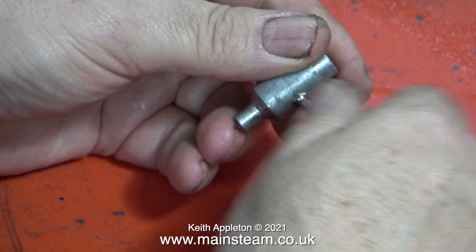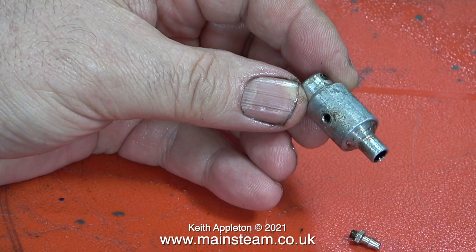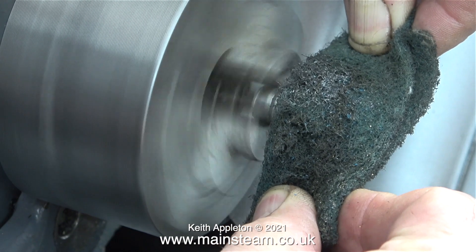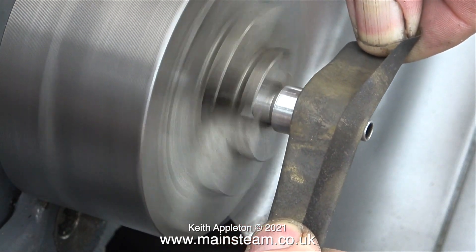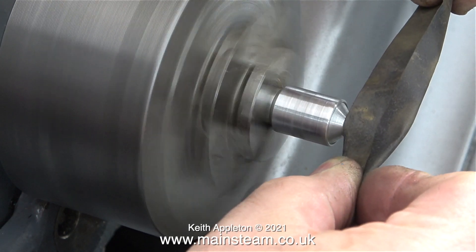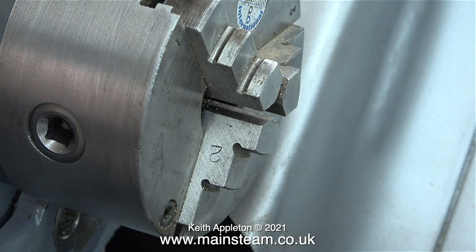The only parts that didn't clean up particularly well were the silencers. This one from an OS engine is quite tarnished. The best tool to clean it up is my Myford lathe in the workshop behind me. Scouring agents were ineffective because it's quite badly pitted, but I got better results using wet-and-dry sandpaper — 400 grit — and now it's cleaning up very well. Unlike ultrasonic cleaning though, I'm removing metal to get this one clean.